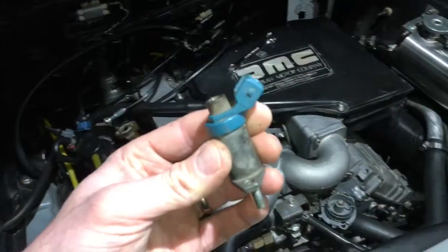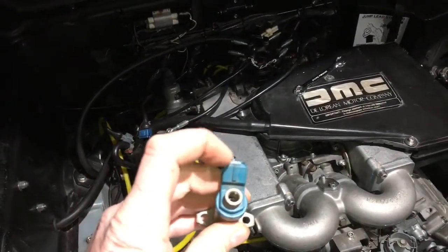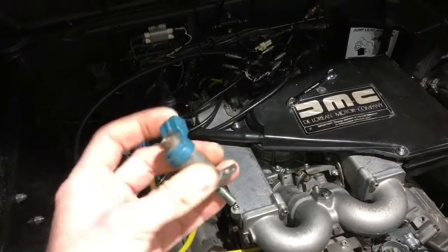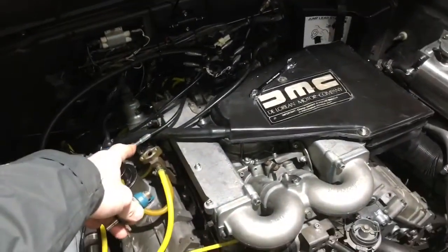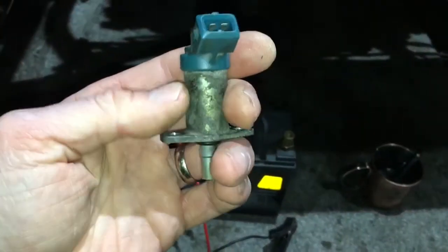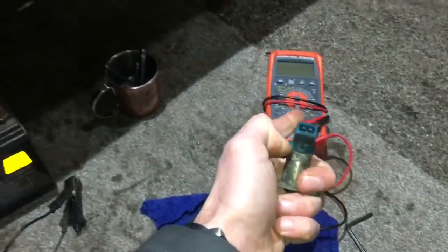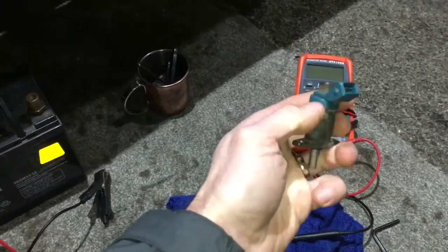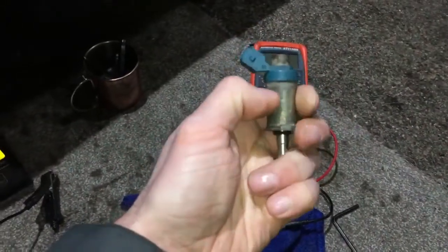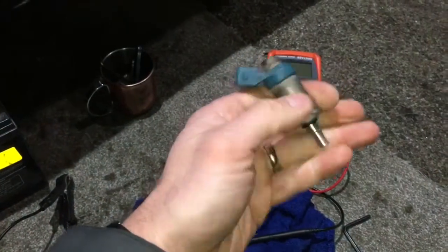What I want to see is whether mine was working or not. I left it in place, connected up 12 volts to the two terminals — it did absolutely nothing at all. Checked there was fuel in there, there was. Did it again — nothing at all. Took it off, put it onto the battery, connected it straight up — it does nothing whatsoever. It does just have a little flicker of power. I've checked the continuity and there is continuity, so the electrical circuit we believe is correct, but it's just the actual solenoid mechanism inside which is not working or it's jammed.